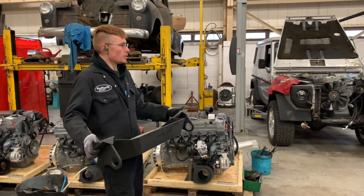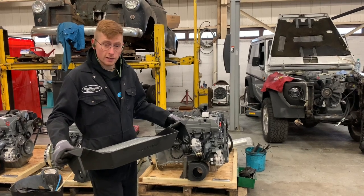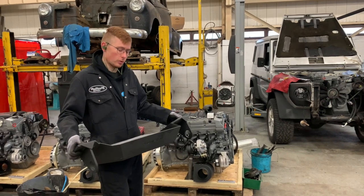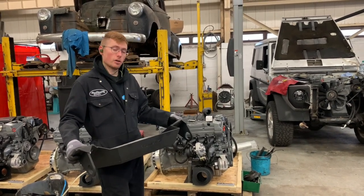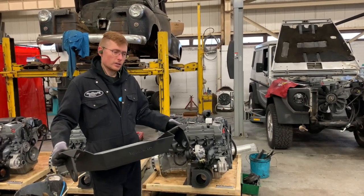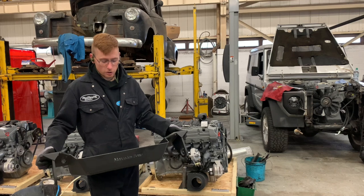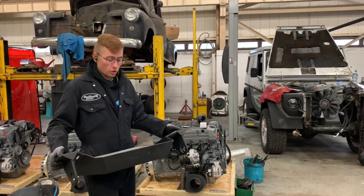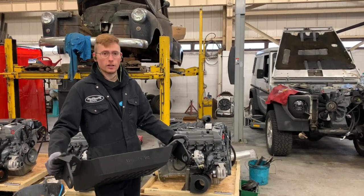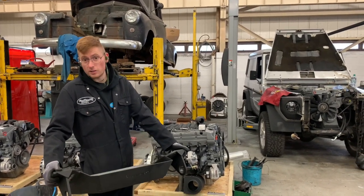And the engines, packages, and things that people want to put in them are far more powerful than what they were originally designed for. So, to get around that, we have to put a large intercooler, large radiator, and all the rest of it, but what you cannot do is cover one up with the other, because you end up with a Robin Peter to pay Paul situation where one item's cooling is stealing from the other. So we've used a kind of a method like Mercedes did, where the actual cooling for the intercooling, etc., is mounted lower down in the bumper area, just like a G63 is.